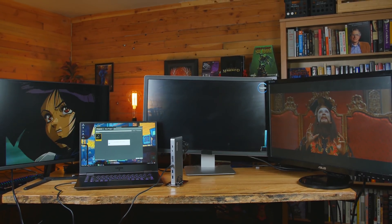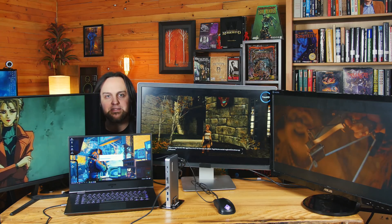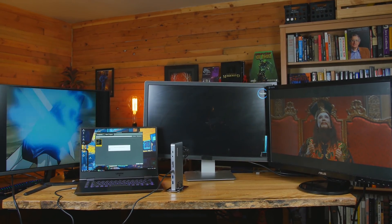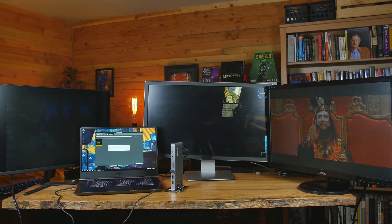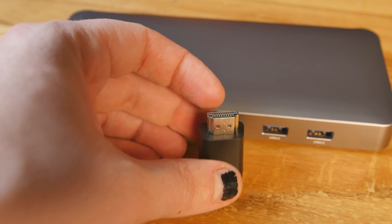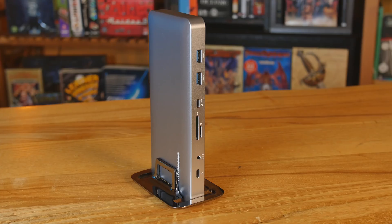You'll see a 4K HDMI and a 2K HDMI on the back. So does that mean this thing will support 4K over USB-C? Yes — but if you're going to use 4K, that's it: one 4K monitor at 30Hz. If you want two or three monitors, you'll have to bring it down to 2K or 1440p for one monitor and 1080p for the others. Also, if you're worried about VGA support for legacy stuff or projectors for presentations, they've included an HDMI-to-VGA adapter in the box.